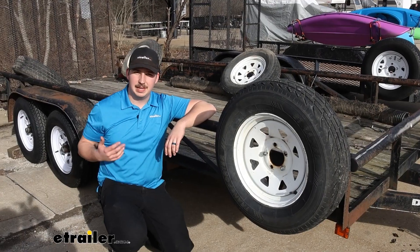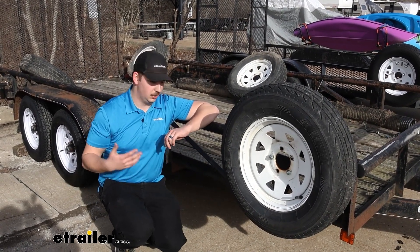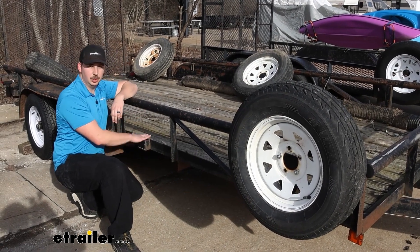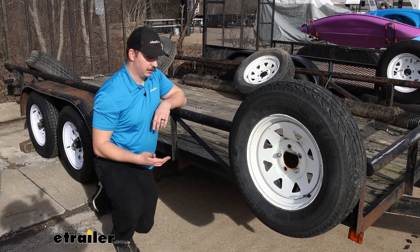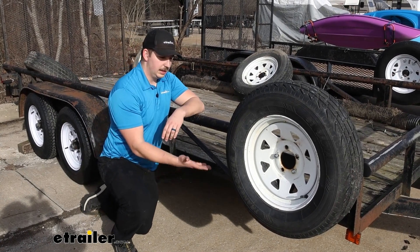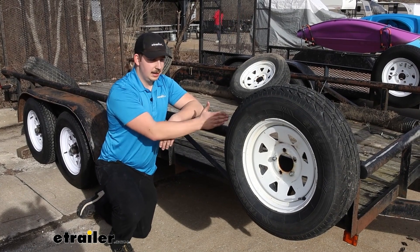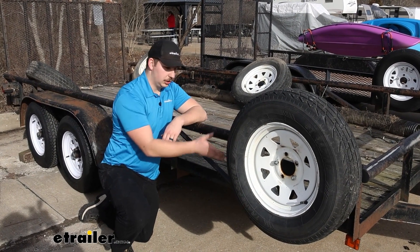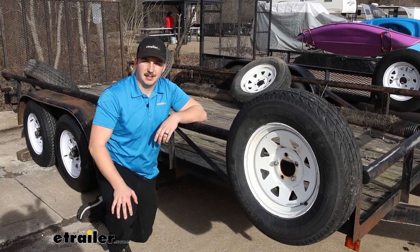The carrier is going to be angled, which helps get more ground clearance and clearance away from the side of the trailer. On our application today, our stake pockets are located directly below our railing, which does present a problem with mounting. But luckily, the carrier gets the tire up 7.5 inches from the stake pocket and out 6.5 inches from the side of the trailer, giving us good ground clearance and clearance from our railing.